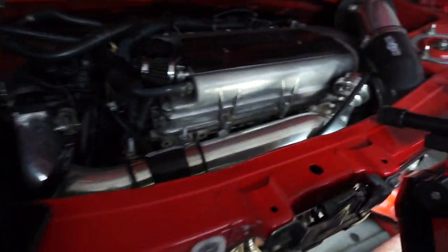What I think it is — if you come up here, there is a tiny timing chain tensioner, and I think that's causing the oil leak. I'm gonna get a better angle to show you guys. There it is, that little part behind there. We're gonna get that and pull it off.